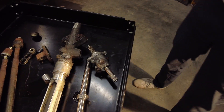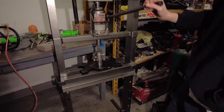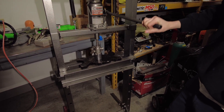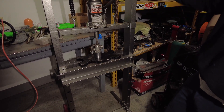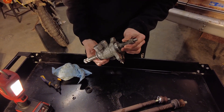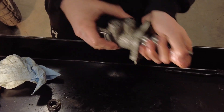Should we use the press to try to take this shaft out of that housing? We must have missed a snap ring or something — that's so much force. It's going out now. Matt told me how this works because I got it backwards. This part was up through there like that — it goes back on so much easier when you put it the right way. That guy was up there like that, then popped it out.